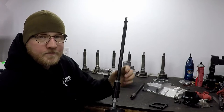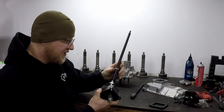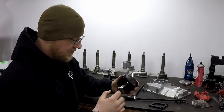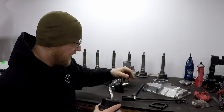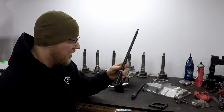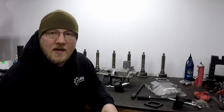The same Dodge shifter assembly will also fit onto an NV5600 shifter. The NV5600 shifter mechanism itself looks quite different but the thread pattern is Dodge spec. You can get this exact shifter listed as 98 and up on Advanced Adapters' website and screw one of these onto your 5600 shifter — I personally run one and love the improved shift feel. You can check us out at www.lrgdiesel.com or call the shop at 509-499-0760. If you've got any questions comment below — keep shifting guys!